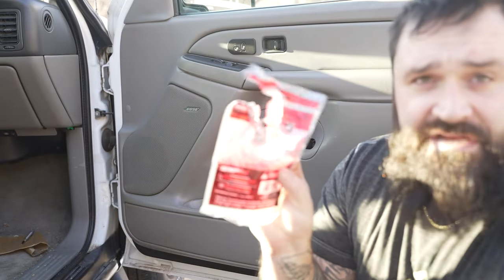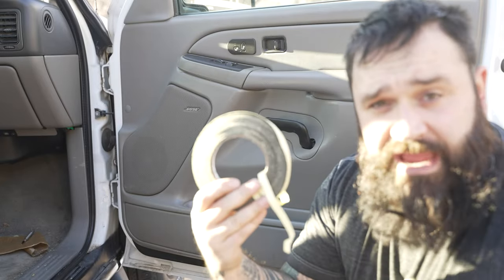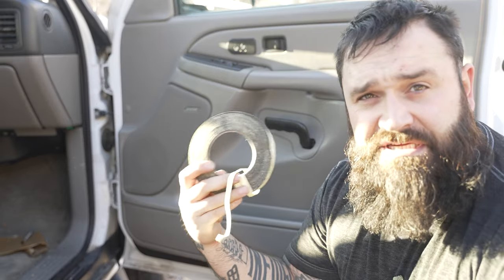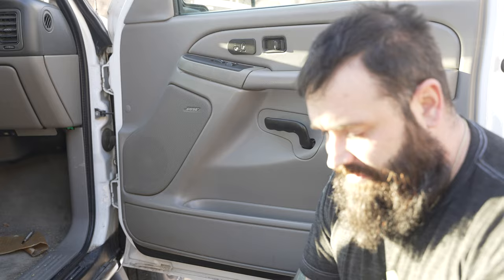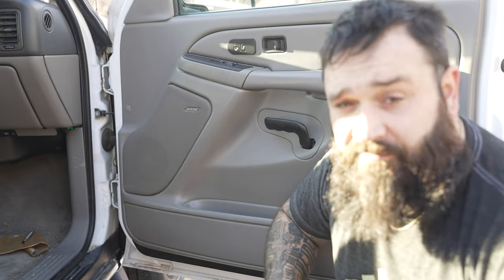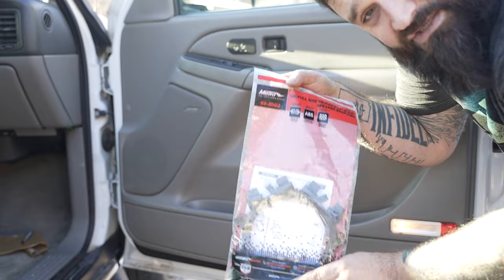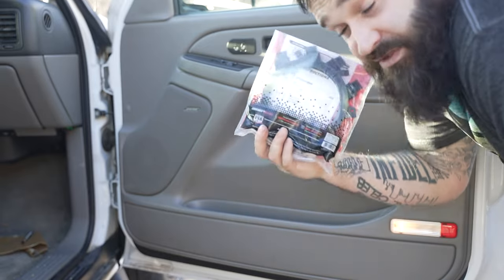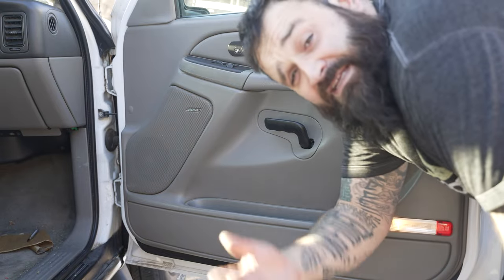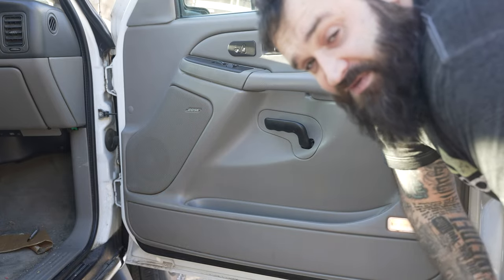Install is done. Door panel's back on. A-pillar's back on. I'm going to link the 72-4568 Metra connectors for your speakers, the 10-millimeter single sticky-side speaker gasketing, and the speed rings — but be careful which ones you buy, some won't fit six-and-a-half-inch speakers, these will. Also remember: do not buy the 82-3002 — they won't work for six-and-a-half-inch speakers. If you're just doing six-inch or five-and-a-half-inch, they'll be fine. Anyway guys, that's the end of the video. Hopefully this was helpful — leave a thumbs up if you want. There's going to be a whole video series project on this truck, so subscribe if you want to see that. Thanks for watching, have a great day!